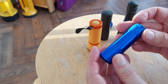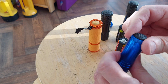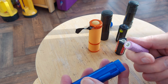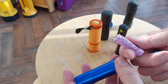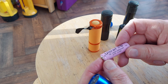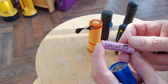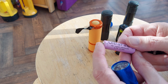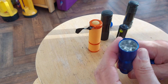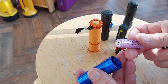That's a really simple modification. You do need the right charger for lithium-ion batteries — you can't just stick that in an ordinary nickel metal hydride charger. But usually when you buy these you can buy the charger at the same time relatively cheaply. So if you want to convert one of these to lithium-ion, that's probably your easiest option.